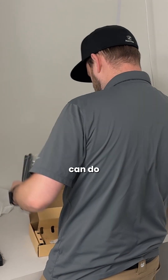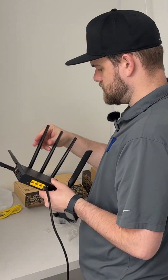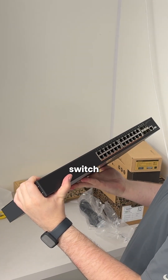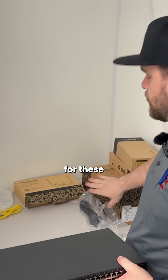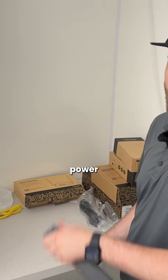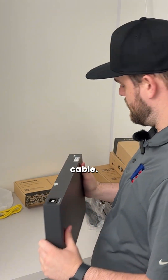Then the next thing we can do is get all the different antennas connected. This is a 24-port switch that also does PoE, which we will be using for these access points to get them online. PoE is Power over Ethernet, so that means you don't need an extra power injector to get those access points online — the switch itself can supply both data and power through that one cable.